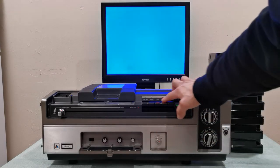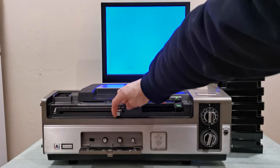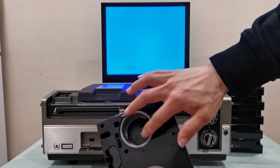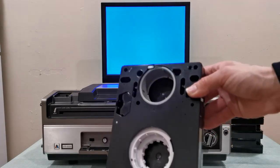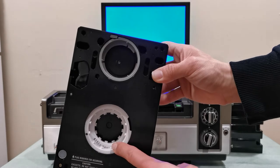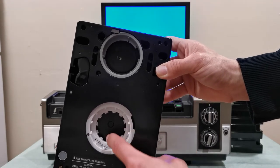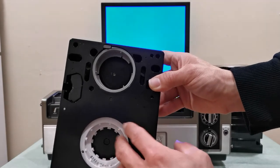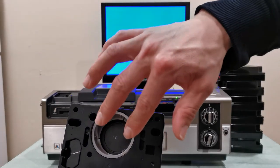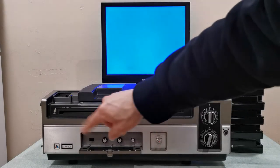Let me press play — it says 'play,' so you move this towards the right. Before you stop playing the tape, that action places back the plastic cover so we can actually read the tape. Let me show you a bit how these tapes work: these are dual stacked spools, very similar to cartridge format. This is also similar to the VCR format from Europe, but on those formats the tape came out of the cartridge onto the video drum, whereas on this format the video drum actually goes inside — that's one reason why these cartridges are so big.